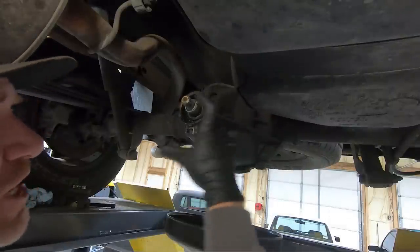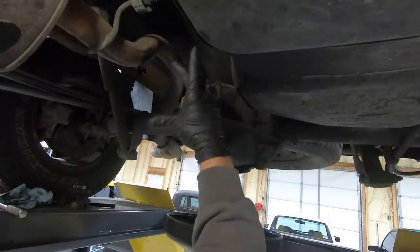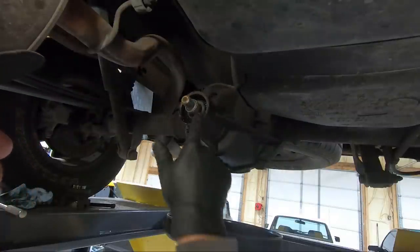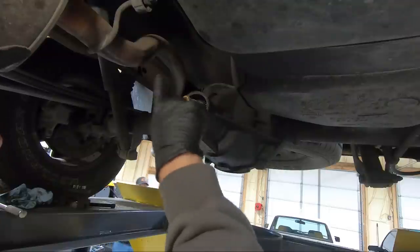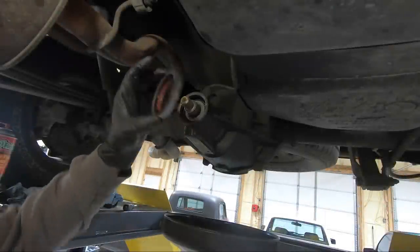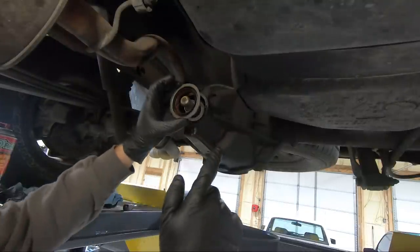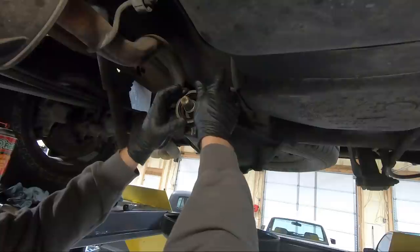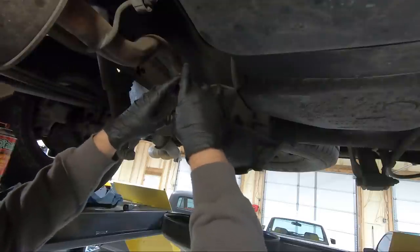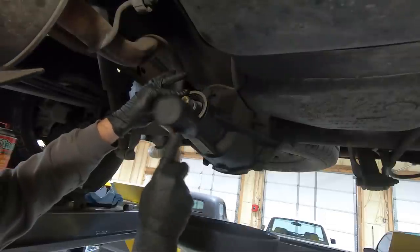We're either going to put a little bit of grease on the new seal. If it's a GM one — which I'll list that part in the description below — it comes with grease on the inside, but I like to put grease on the outside just to make sure it goes in smoothly. We're going to need the new seal, a little bit of grease, and I'm going to use a rubber mallet to tap it in place. We're looking for this outer ledge to be flush with the rear end.